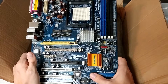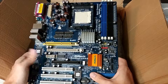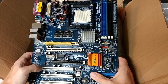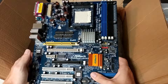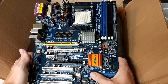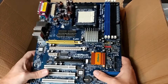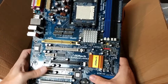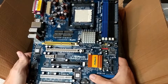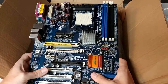So essentially you have full bandwidth PCI Express and AGP. The other motherboards that they made do not have this feature — they either had to run AGP or PCI Express; I think it was actually PCI Express they had to run at only 4x speed in order to get full bandwidth for AGP. Other motherboard manufacturers have AGP slots that are basically PCI slots with a different shaped socket, running at PCI speeds, coming with names like XGI or AGI. They weren't able to call it an AGP slot even though you could fit AGP cards, so performance was extremely limited. This will allow full performance for PCI Express 16x and AGP 8x. And I'm going to test to see if I can have two graphics cards plugged in at the same time and just use Windows to switch between them — that would be cool.